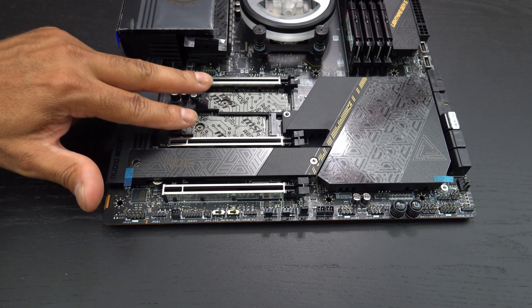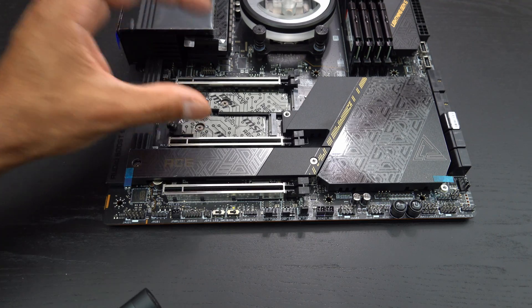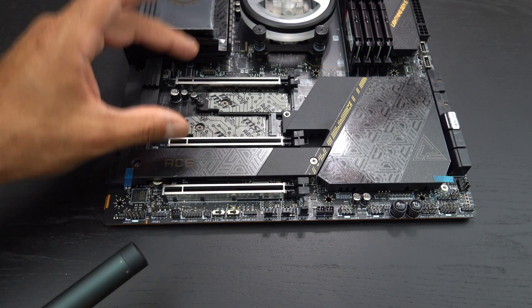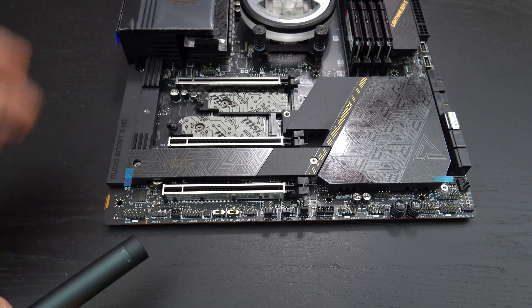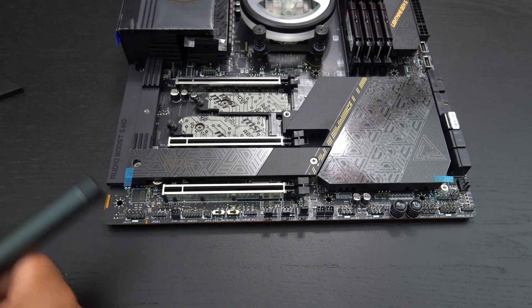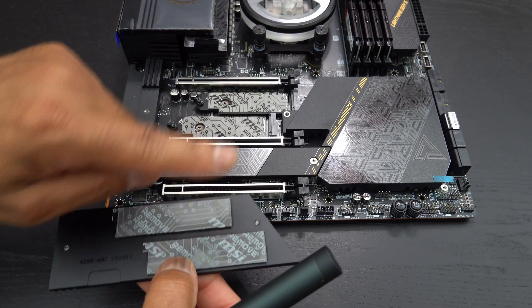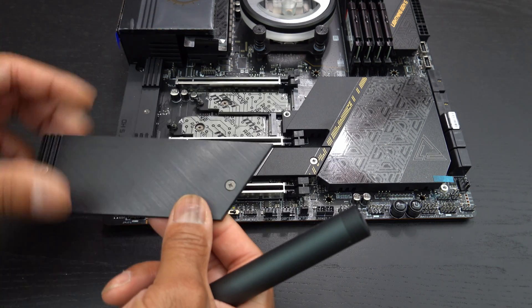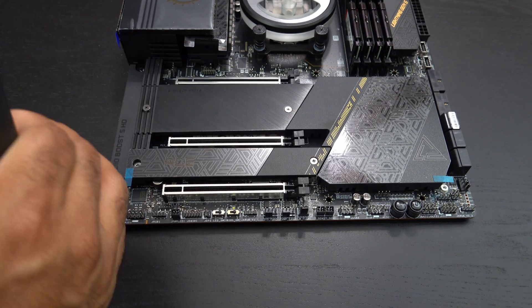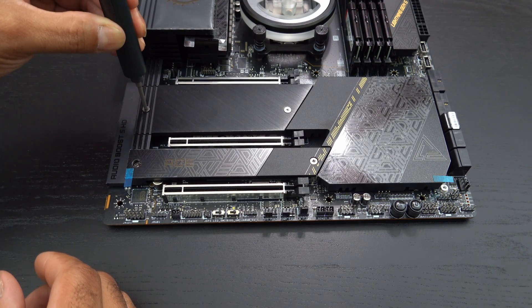The reason why I'm not going to use these two slots right away is because GPUs are really hot, and that's going to take up a large chunk of area right here. So if I have like a 3090, 4090, 5090, this whole area is going to be kind of hot — unless, of course, I'm water cooling, which I probably will. But that's one good reason to have dual pads here on the bottom and the top of those M.2 NVMe drives. So then this just falls into place right here, and this thing is solid — it's no joke.